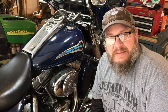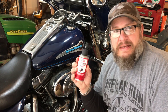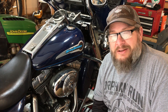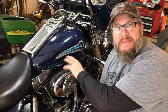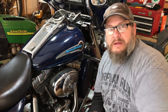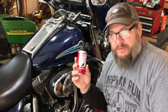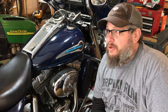So we brought the customer's bike back in today to take the air cleaner off and get into the throttle body. We picked up some throttle body and air intake cleaner — got this over at Walmart, it's like seven, eight dollars for a bottle. It is similar to brake cleaner, but it's much less aggressive. So if there are sensors inside that throttle body, it shouldn't affect those sensors or corrode them where a brake cleaner might. So you want to be really careful on what you use inside that throttle body — definitely get something designed for it, throttle body and air intake cleaner. I'll put the link in the description to everything we use today.